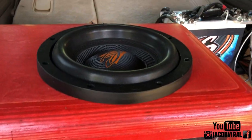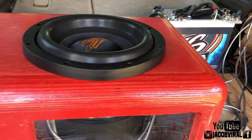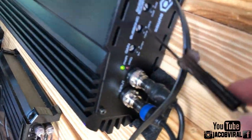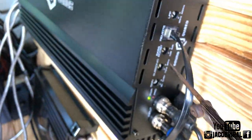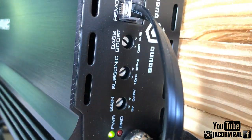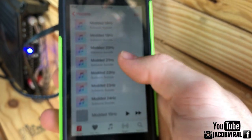What I'm going to be doing in this video is showing you this test I'm doing to tune my amplifier's subsonic to where my subwoofer is protected and not bottoming out. I'll go ahead and grab my tool — it's not the prettiest but it works. It's a little gauge I use to adjust tuning settings on my amplifier. I'll start with the subsonic all the way off. If you don't know the tuning of your enclosure, this is also an easy way to find that out.